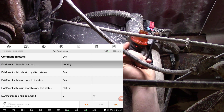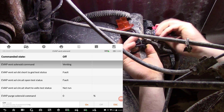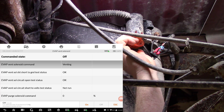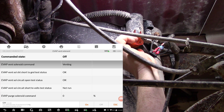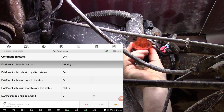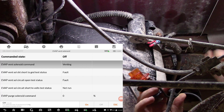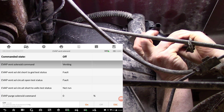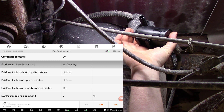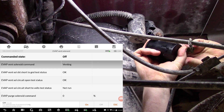To do that, I'm going to use a noid light plugged into the connector to see if we have control of the solenoid. So I click on — and you can see off, on, off — we do have control of this solenoid. That tells us the solenoid itself is bad. We're going to take the replacement solenoid, plug it in, hold on to it — and you can even hear it popping. So we know that replacement solenoid is good, and I'll go ahead and swap that out.